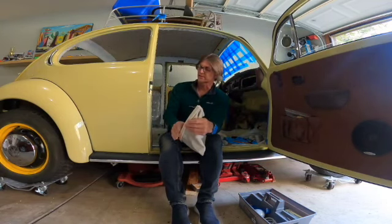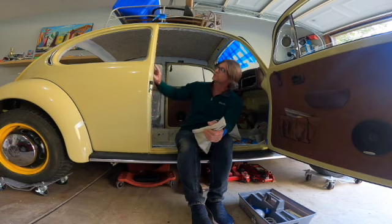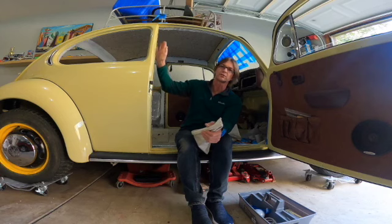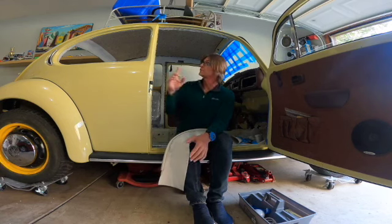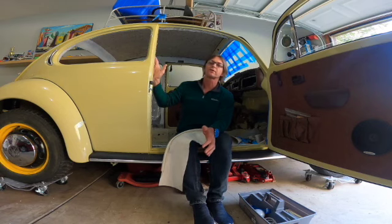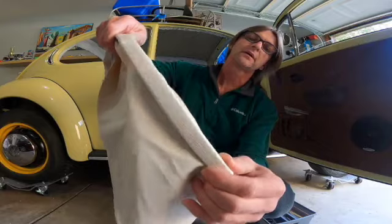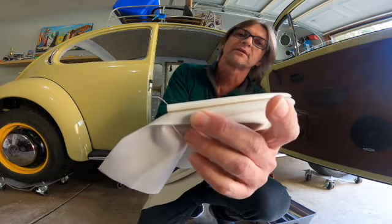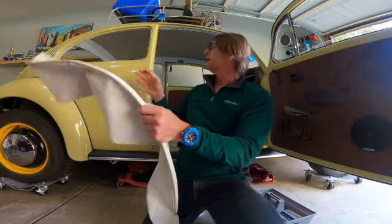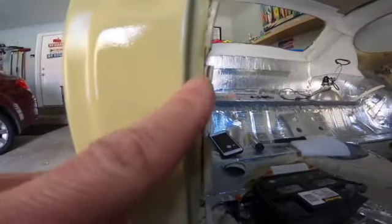We're going to slide the wind lace into the clippers. After we slide it in, we'll take a rubber hammer and bend them in to fasten the wind lace. After that, we're going to grab a piece of poly wrap that I use for insulation and cover the clippers to provide a nicer, smoother surface. This right here is the wind lace — it's a thick rubber piece with a groove in the back where the clippers clip on and fasten the liner against the B-pillar. These little guys are the clippers.